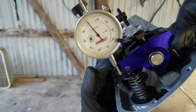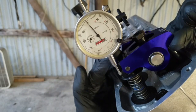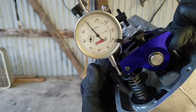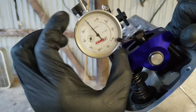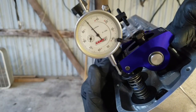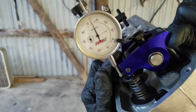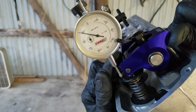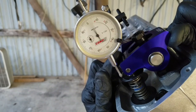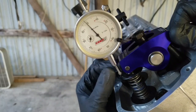I've got my checking springs in here. Now we can just lift it until it hits the piston — and there we go. One hundred and eleven thousandths. So I have 111 thousandths of clearance on the intake valve.